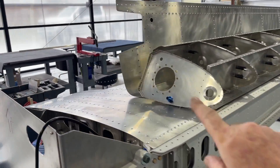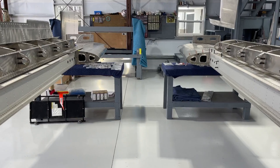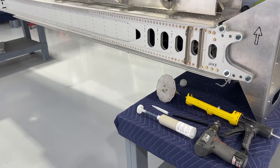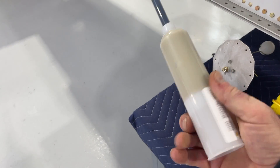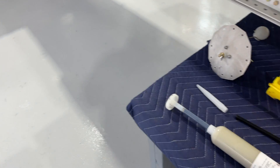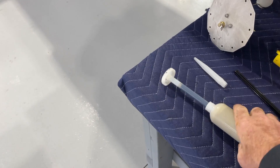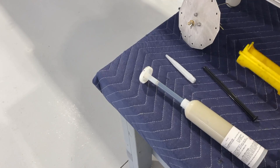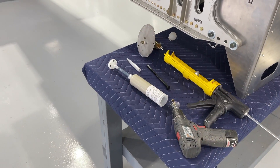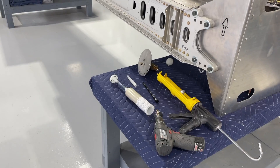There are also a couple of fittings that did not come with my kit that are also on order. Once I receive all the parts I need for the fuel tanks, I'll go ahead and start sealing. Here's the sealant — the 3204 sealant used for this, it is a Class B. This black is the catalyst; you push the catalyst in, then once it's in you can mix it. I've enlarged those holes because I've made my own tool to push in there and mix the sealant up. I've got four tubes, hopefully two for each fuel tank, and I'll probably just do a separate video on the sealing of the fuel tanks.